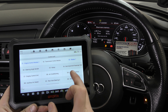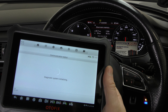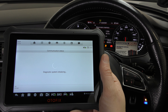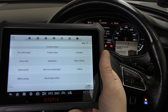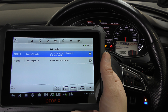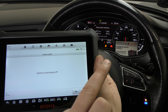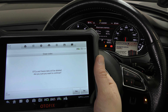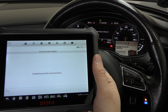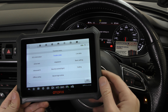We'll go into the airbag system and show you the same again. Again this is a simulated fault where we've unclipped the connection. We'll go to Trouble Codes — forget about the U-code at the top — and erase codes. Keep an eye on the airbag light just there — and there we go, the airbag light has gone off.